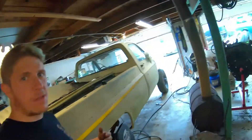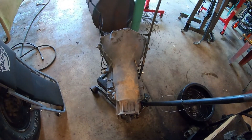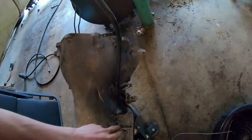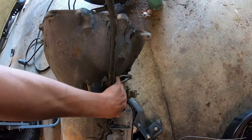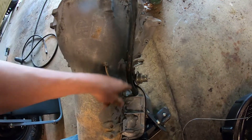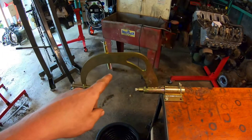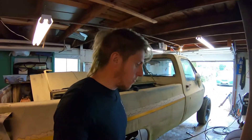Welcome back to the channel, my name is Jason. Today we are going to be rebuilding and upgrading the Turbo 400 for the 6.0 CCV project. First thing we've got to do is get these transmission cooler lines off the side of it, get the dipstick and fill tube pulled off, and then get it up onto our transmission stand to make it easier to work on. That'll also let us drain all the fluid out.